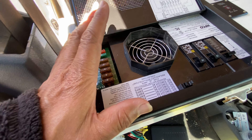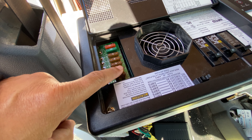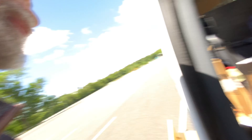My power center converter allows me to run my fan, my lights, my refrigerator, and my water pump all off of 12-volt. It also has a 110-volt side that allows me to run my sensitive electronics. That power center is incredibly powerful and it also acts as a 30-amp converter so I can charge my batteries if I need to. It's been rewired slightly so that the 30-amp charger goes directly into the transfer switch.